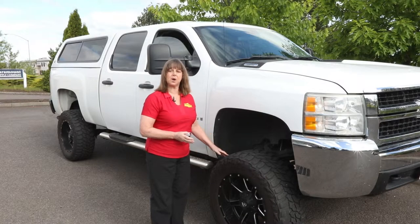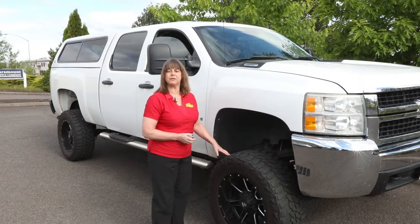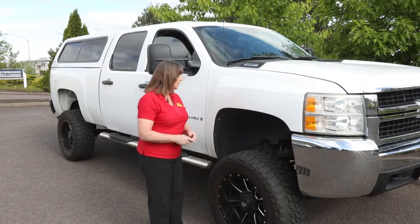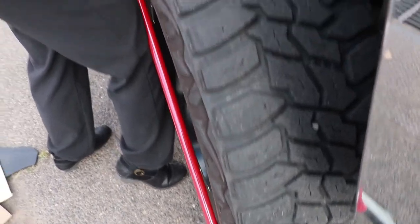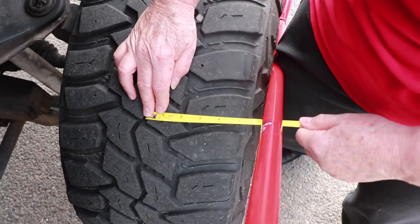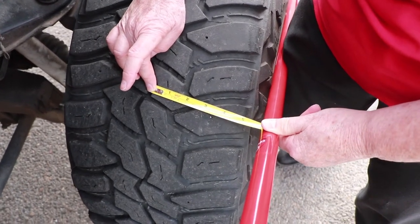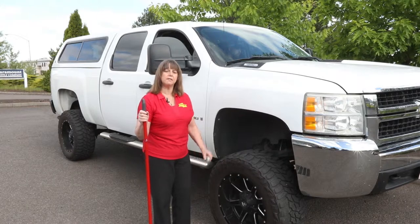To get accurate measurements so that we can properly center the mud flap to your wheels and tires, we also need to know the exact width of your tires. Although they might be labeled 12.5, sometimes they're a little less, sometimes a little more. So what we're going to do is measure from the very center of the tire tread to that same outside edge, leaning against the broomstick. We'll find the center of your tire tread — some treads are a little harder to find, but this one's very easy. So now we're measuring from the center of the tire tread to the broomstick, and that is 6 inches. So these tires are 12 inches wide. We usually recommend our 14 inch wide mud flap for tires over 11 and a half inches wide for complete coverage.